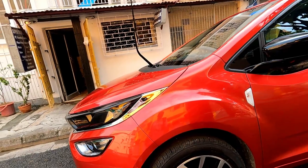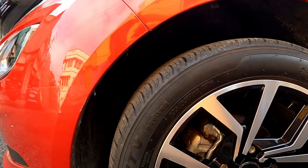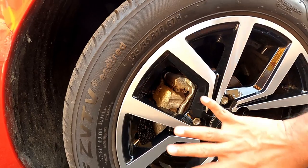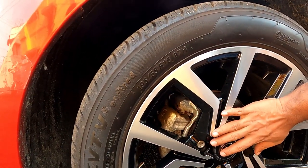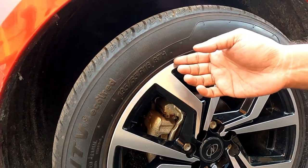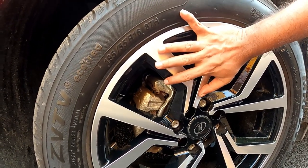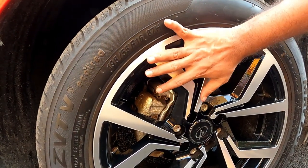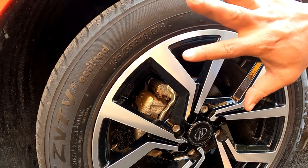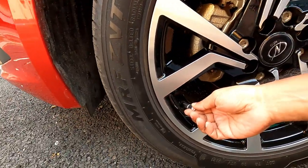Next step will be tyre protection. Those who don't have alloy wheels should open the wheel covers and clean the rims, then use a proper tyre polish to polish both the tyres and the rims so there will be no rust during monsoon season — moisture and water stick to these layers and lead to rusting. For alloy wheels, clean them and apply a good wax protection such as ceramic or graphene to repel water and keep them looking good.